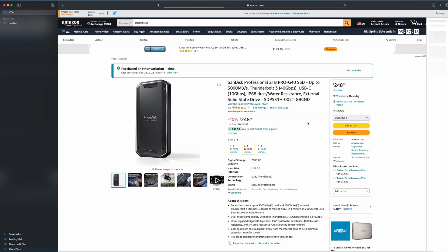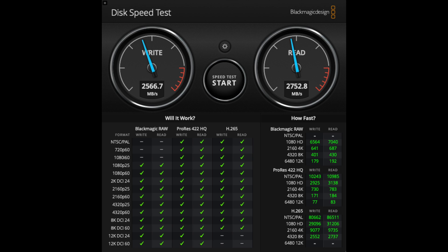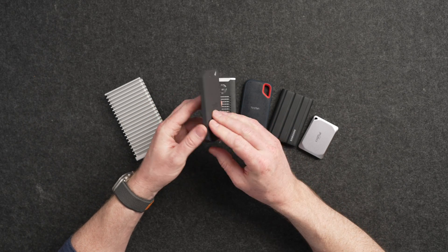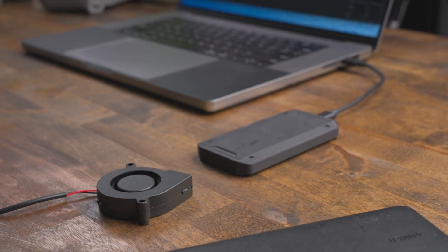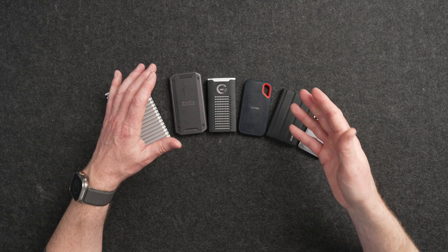Stepping up in price into Thunderbolt 3 territory — if you're going to offload or load a lot of footage really quickly, that's where you have to be because this is where you're going to get those extremely fast speeds. But if you don't want to build your own enclosure and don't want to take the risk of putting your own SSDs in an enclosure, then this is the option for you. This is the SanDisk Professional — an extremely fast built drive that comes ready to go. The issue is that it does handle heat well and will transfer a lot of footage extremely quickly, but it will slow down over time as it gets warmer. So you either need to keep it cool with a small fan if you're going to transfer a terabyte of video footage at once. But if you're just transferring a few hundred gigabytes, it will handle that no problem. It does get warm as you're editing — in fact, all of these will get a little bit warm as you're editing.